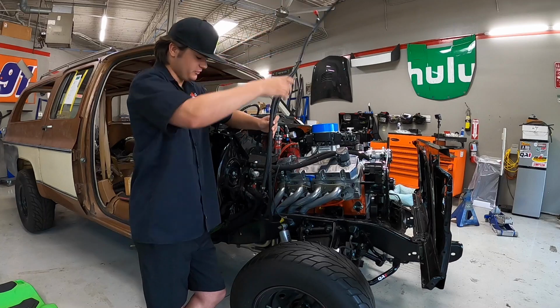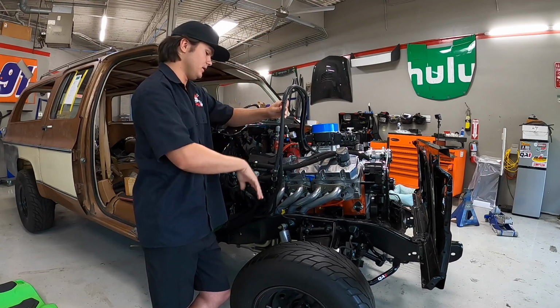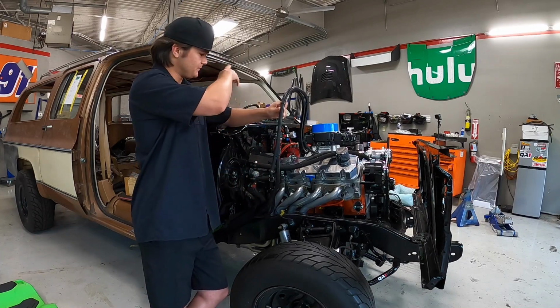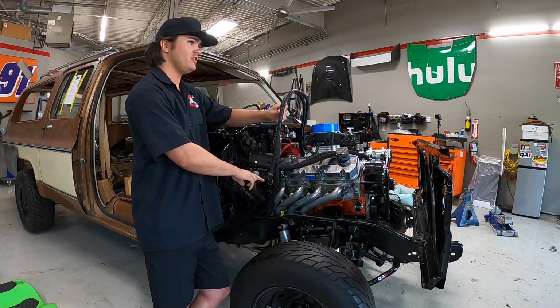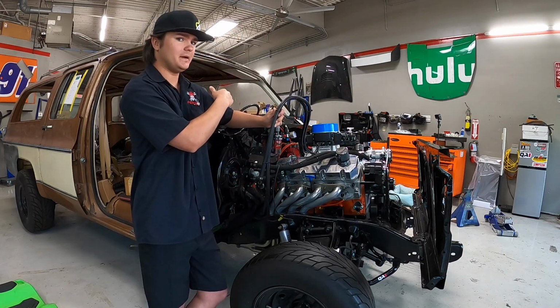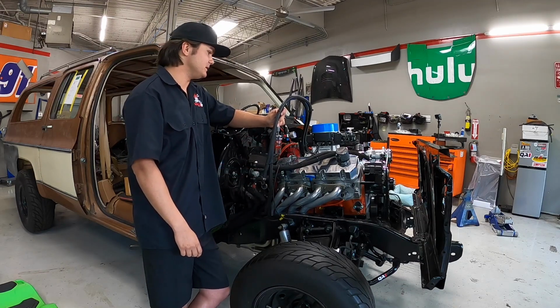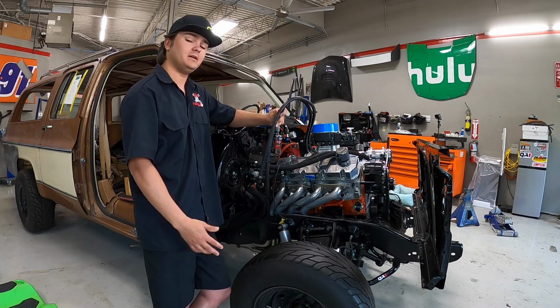I've got a fuel filter in here that we're taking out, so hopefully that'll give me enough line. I don't know. I'll probably just have to put some AN fittings connecting a new hose up to the regulator. We've got another fuel filter, but I'm probably going to put that somewhere on the back of the frame. So yeah, I'm going to get that done. Hopefully it goes smoothly. Not sure it will, but you can hope.